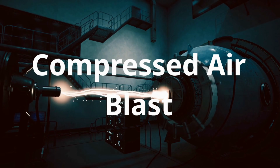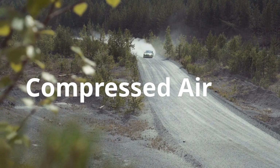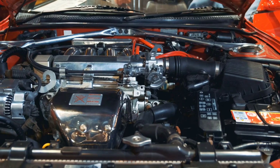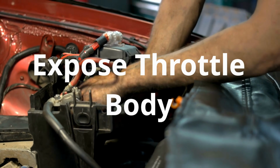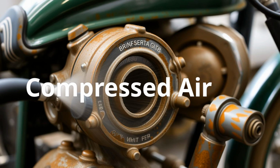Number 4. Compressed air blast. If you drive in dusty conditions or off-road, debris can build up quickly, and here is where a compressed air blast might be the best option. What to do? Expose the throttle body just like you did before by removing the air filter or loosening the intake hose. Use a can of compressed air or an air blower.